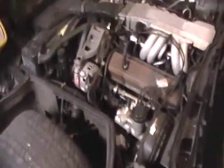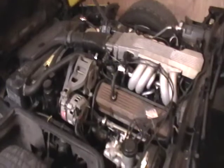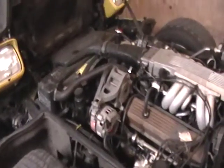And the reason we're doing this is because after a 50-mile round trip in this car the other day, I parked it, I let it sit for 2 days, and I came out to start it, and the battery was really drained, kind of low. So being as we know this is a new battery, we're going to go ahead and give some attention to the alternator.